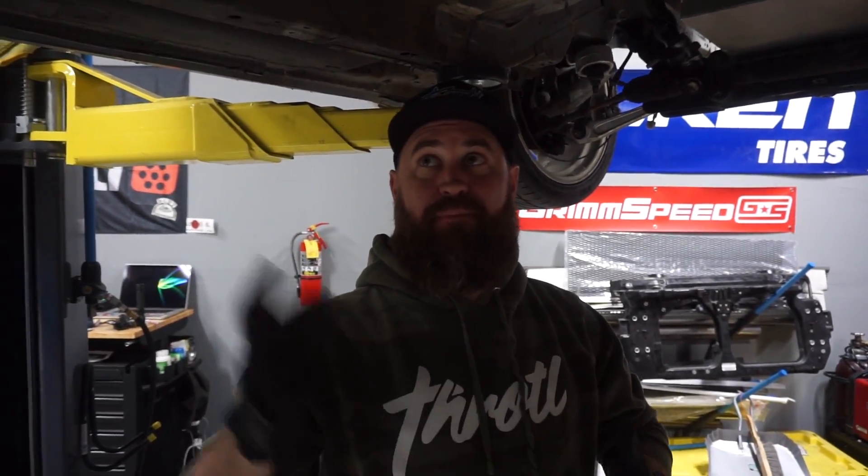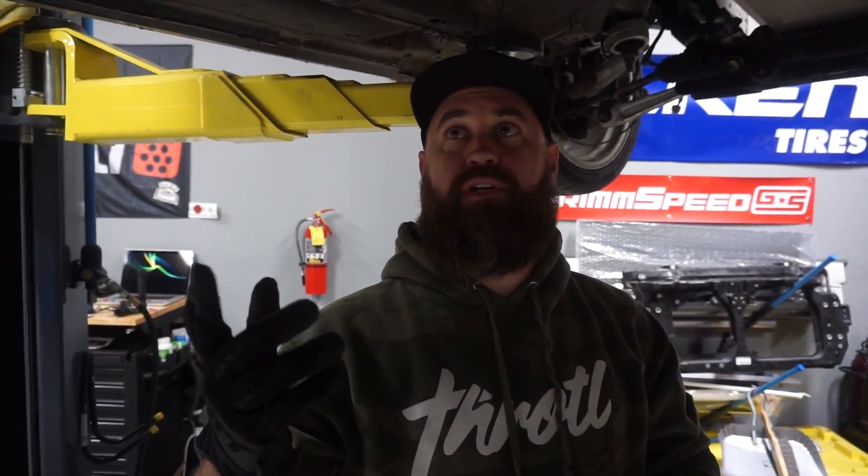A lot of you guys probably don't realize this, but the batteries are actually water cooled just like an engine. We will be utilizing peak coolant on this build, which is really cool. It's something I'm looking forward to learning more about as well — it's really neat technology that allows the batteries to run a lot cooler and last a lot longer. It's not just about the placement of the batteries, it's how they're going to integrate with the rest of the system. Each one of the batteries has an inlet and outlet for coolant to pass through to keep the batteries at a proper operating temperature. The other thing is connecting the batteries to one another so that collectively they can power the car.